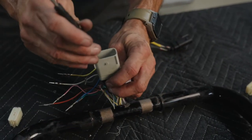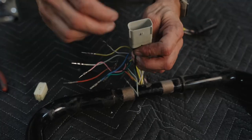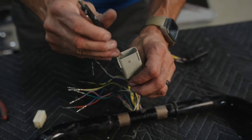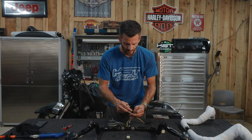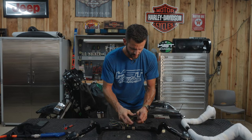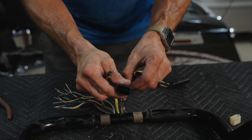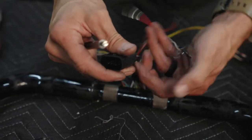Another option: if you just don't want to deal with depinning, you can always just cut the wires — maybe leave about three or four inches away from the plug, cut them, pull them through the bar, and solder them back together. I think that route is harder, but some people just don't like dealing with pinning and depinning. We got all the left side done — I'm going to switch over to the throttle side switch harness. It's the exact same process; just make sure you've got good pictures of the wire locations and plug orientation.